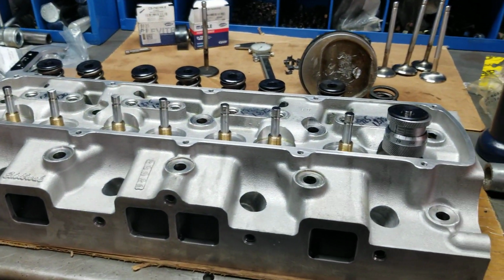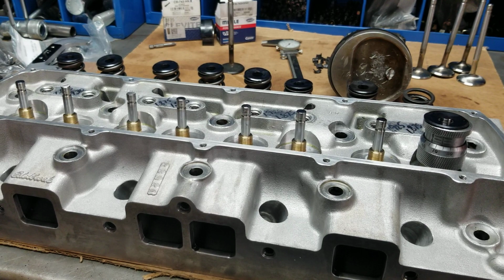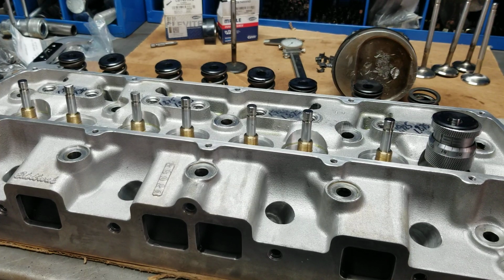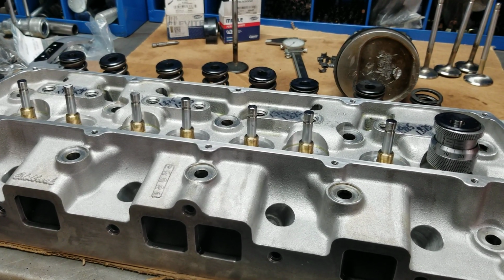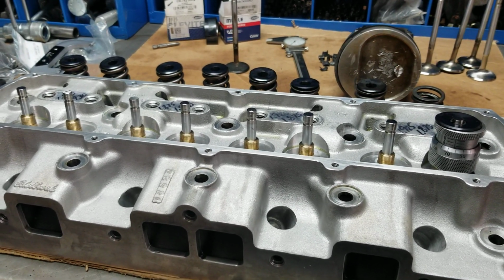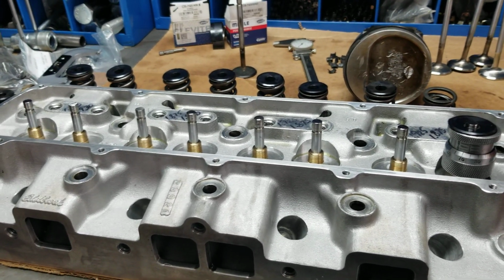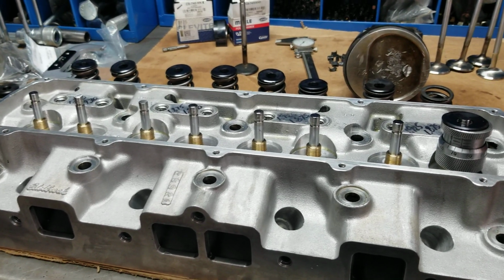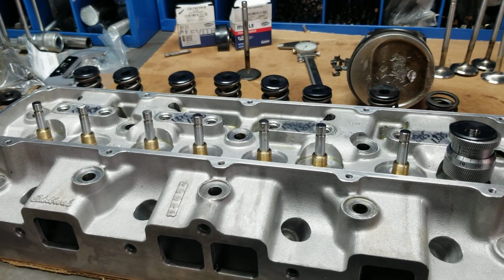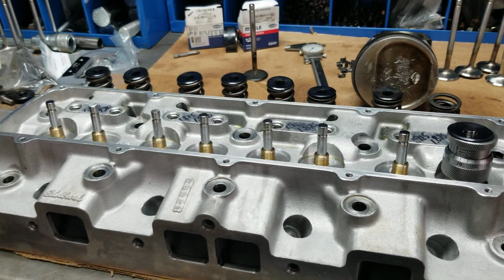What he said is what they found out was they made a pretty costly mistake. And that mistake was that they missed the alignment of the timing chain gears. They missed it by 2 teeth. Typically, you can drive a truck through the piston to valve clearance on these engines for the street, hypothetically 10.5 to 1, mild hydraulic roller cam. That's what this is. So for him to contact all the intakes into the piston, the timing had to be severely off. So with that said, let's go back to degreeing a camshaft.